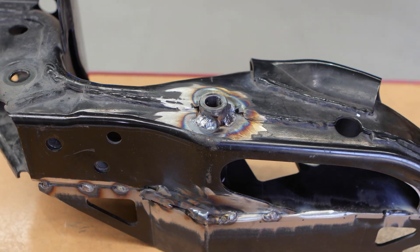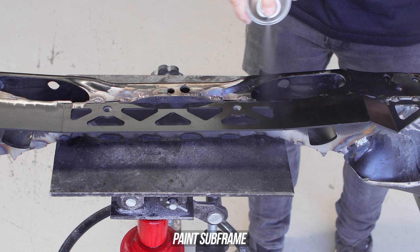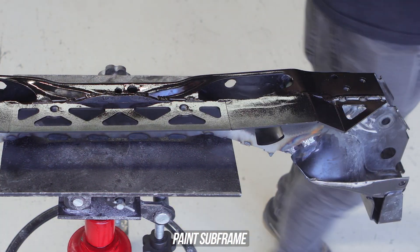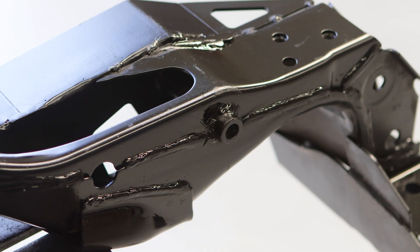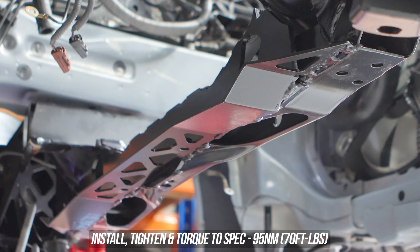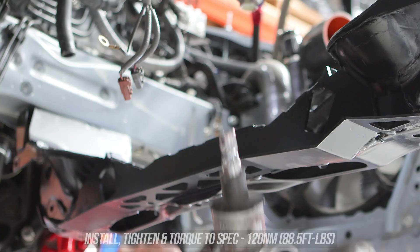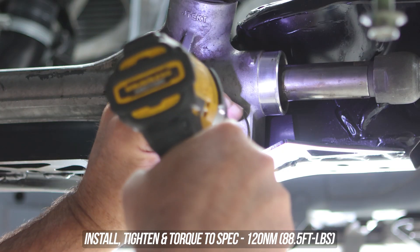If the beads have been sunk in nicely — like ours as an example — pay the man and we can now paint this sucker outside of the car. Throw some paint up on the top; you need something over the top to protect that raw metal and avoid those rust demons. Once the paint is set, refit the subframe back up again and tighten and torque it to spec. Then go ahead and throw the steering rack back up in its place, also tightening and torquing that to the main specs shown on the screen.